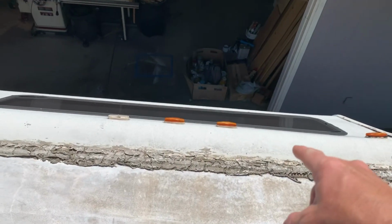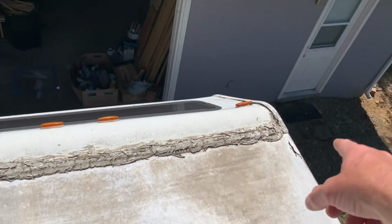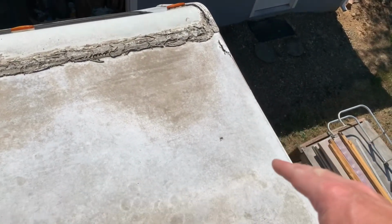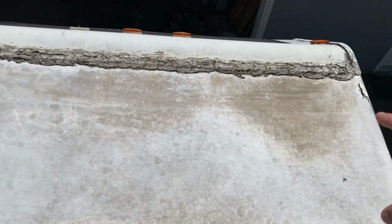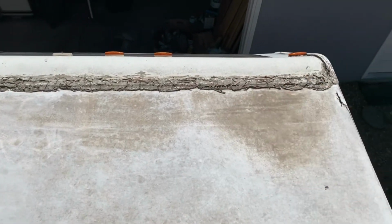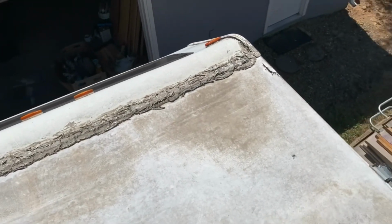So I'm going to suggest rebuilding the entire front cap. So removing the window, removing the trim on both sides, pulling the fiberglass back, reframing all that in, pulling the roof back to the antenna. There's a truss that goes right along here, replacing this section of roof deck, which is just OSB. So replacing that, putting the roof back down, and resealing everything.